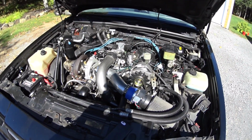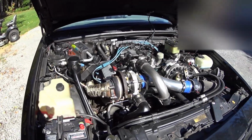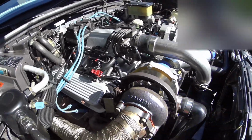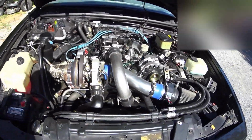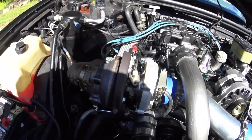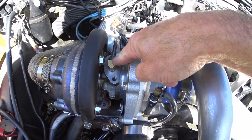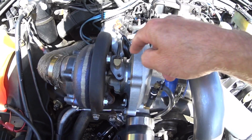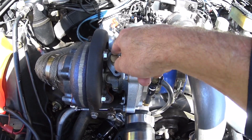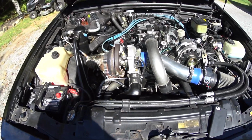The first cool down is done. I'm really surprised there is no fuel leak. The fuel pressure is perfect. But I had a little oil leak in the turbo oil feed. I think the fitting wasn't tight enough. I tightened it, so we'll see at the next startup.